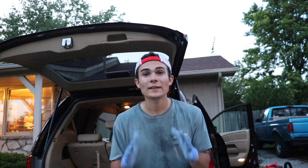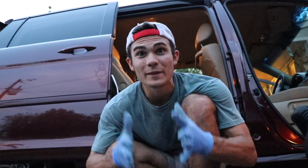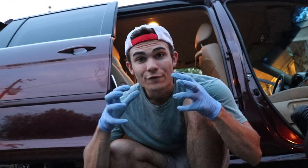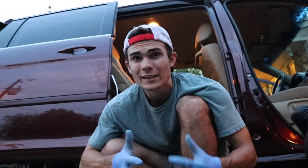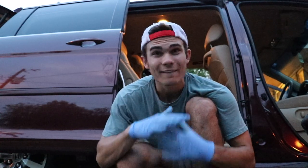And so a couple things to note if you're gonna use this method. Number one, it's a good idea for it to be a sunny, warm day outside, because you're drenching the floor mat with so much liquid that it's difficult for that much of it to dry if it's cloudy or if it's cold. So just understand that you need to be in a place where the drying process can happen efficiently. You don't want to leave that much moisture in a carpet for an extended period of time, because things mold very easily.